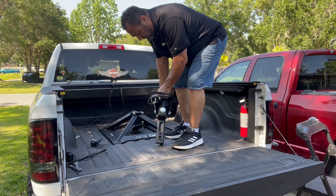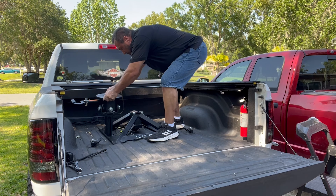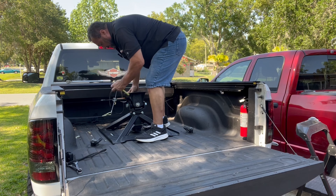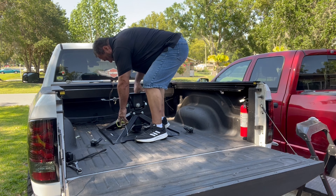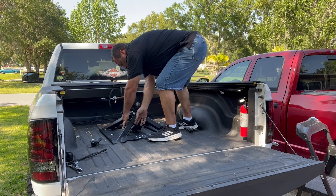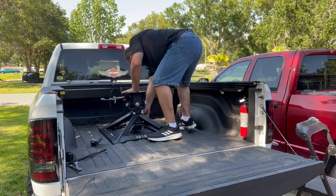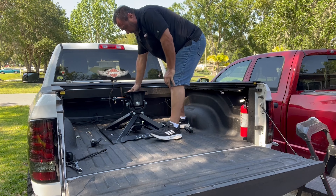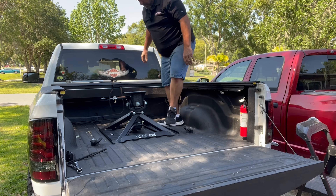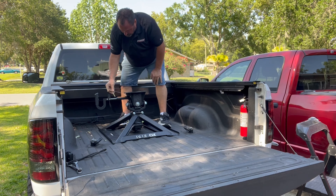On your head unit, it's got an adjustable height to it. Your handle goes to the driver's side. Just for the sake of setting it in here, I'll just pick any hole it falls into. And that's that. Bring this guy around and pin him. Now, as I said, the holes are adjustable, so you can raise this up or down depending on your hitch height of your fifth wheel. It's hard to believe it's that simple, folks. And we are ready to hook.